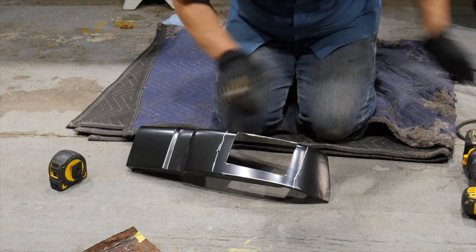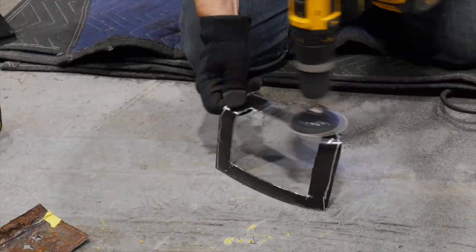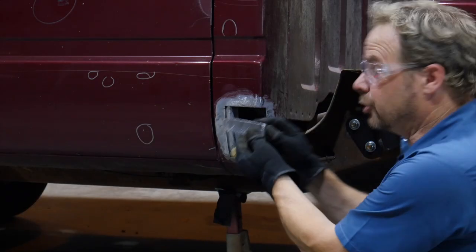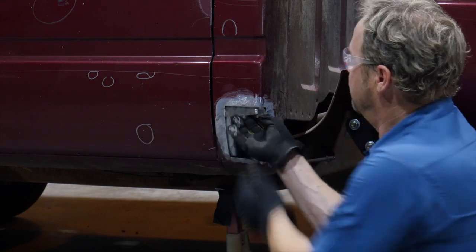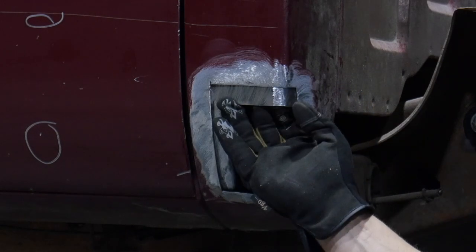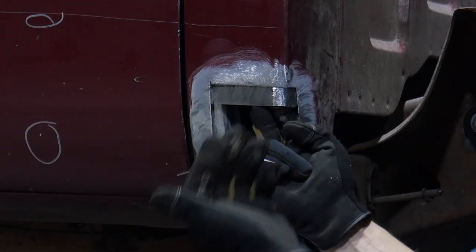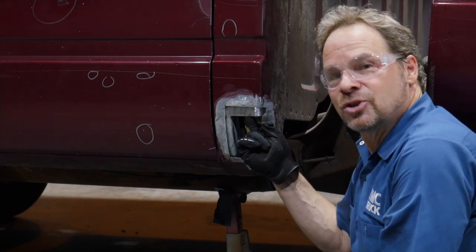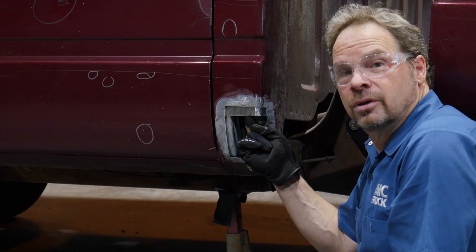I'm going to create my backing strips from the cab corner patch — going almost an inch in all the way around. What that does is give me the same contour and the same basic shape that my whole panel has in the first place. We're not randomly making patches. The saying is 'eat the whole buffalo.' This piece matches the contour of the cab corner nicely, but it goes on the backside. You can see there's enough contact area behind this cab corner to have a good bond between the backing strip and the cab corner, and we've got a really nice landing zone for our patch to go over top. That's the strength of this bond — it's called a backing strip. You've got one, two, and a quarter opportunities for adhesion. It's really quite strong, especially on a small patch like this. You've got to have access to the backside to clean it up and get your bare metal with an aggressive 24-grit tooth.